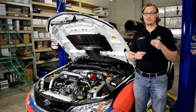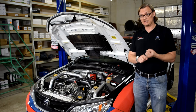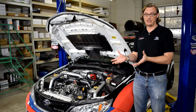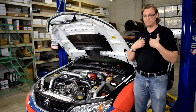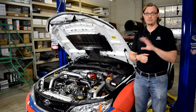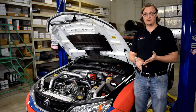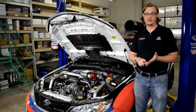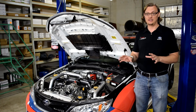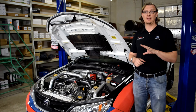Those two uses are available if you have the ability to install it — so TGVs are deleted, because that's how the wiring runs, and your car is compatible with Cobb's flex fuel kit so that the tuner can turn that function on once you connect to the fuel pressure sensor. It makes the car a lot safer and more reliable to drive, especially if you're pushing it hard. Talk to your tuner first, because the tuner has to turn all of that on.